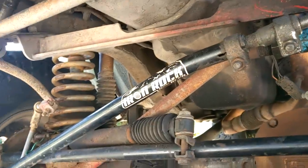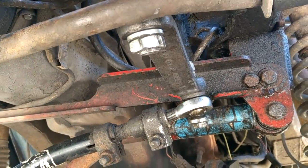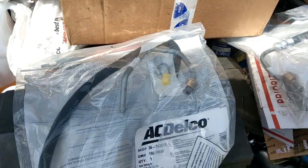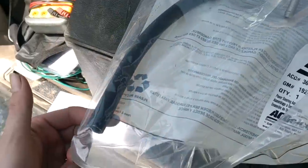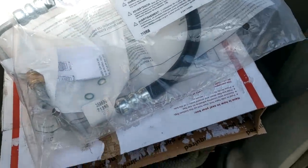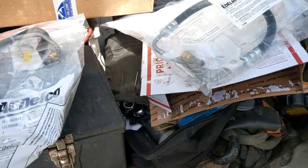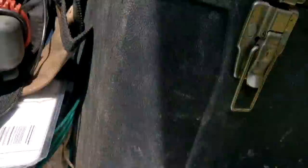Let's torque it down. Now I guess we can adjust the drag link and tighten that down so it's at the right angle. And steering lines — then we'll look into the bleeding. Today's video is not sponsored by Rock Auto — a company that'll actually get you parts the same month. We've got our two replacement hoses: the return line — big rubber hose with fitting — and the high pressure line with fitting on both ends because I messed up both of mine. This one even comes with O-rings, because O-rings are important. I'm going to see if we can wiggle this stuff out of the old power steering pump and put the new ones on.